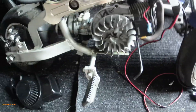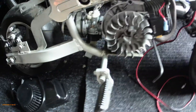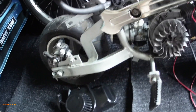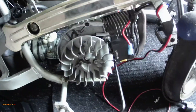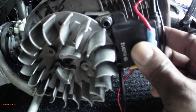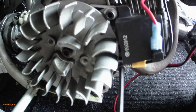Today is Saturday April 2nd 2022. The other day I was doing a test here with the bike and it stalled. I actually thought the gas was low but when I checked the tank it was fine. Took the cover off and lo and behold the coil was loose.